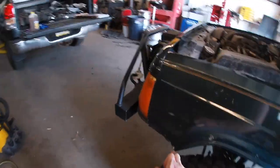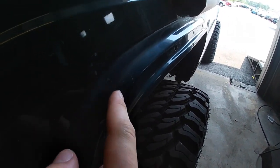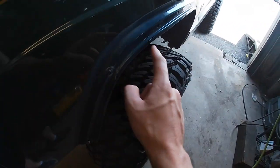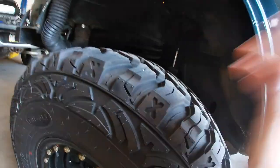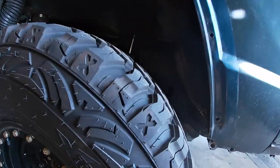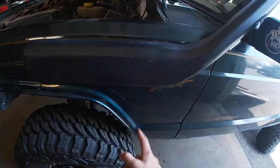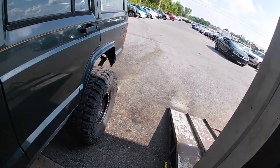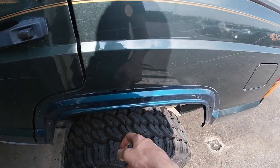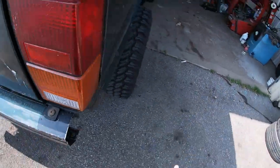What we're doing is cutting off the little lip on the fender right here, because my tires rub at flex. I don't think they rub at full lock anymore since I took the flares off, but they definitely hit on both sides when flexing. We're going to trim that up and then put some notches in there and hammer it up - basically a tuck and fold. I don't think we're doing anything with the rear quarter panel cap.